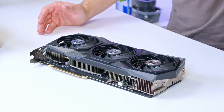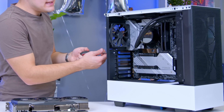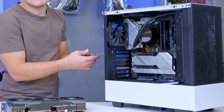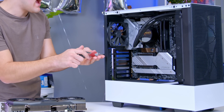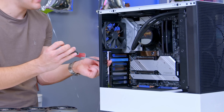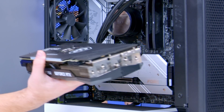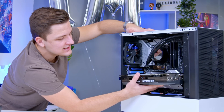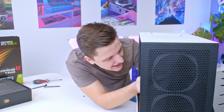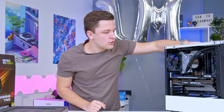Remember, the 3060 Ti is not replacing the 3060 — it's just a level up, released at basically the same time. For this build, we need to remove some rear PCIe lane covers, taking a screwdriver to the second and third slots. With some angling to work around the case lip, the GPU clicks into place and is secured with the same screws removed just a moment ago. It actually fit a lot easier than expected, and we have an additional 30 millimeters of clearance after the radiator — something to keep an eye on if pairing a radiator and GPU in the H510 series.